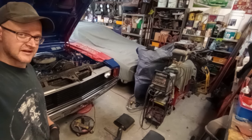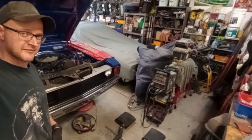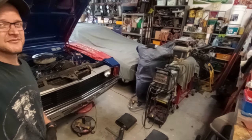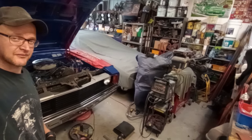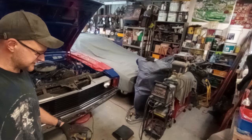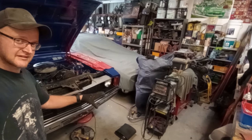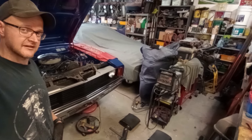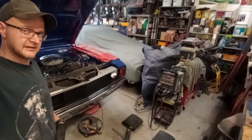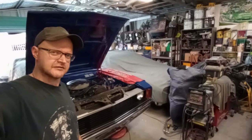And then after that I'm going to put some hangers under the car. I've got a pair of OEM hangers to suit a sedan, which I'm going to need to modify because the floor pan is different. That's okay, and once this exhaust system is under the car and the hangers are attached to those mufflers, calling it, that's it. I'll pick the rest up on another episode. Hopefully with a startup video. That'd be nice.